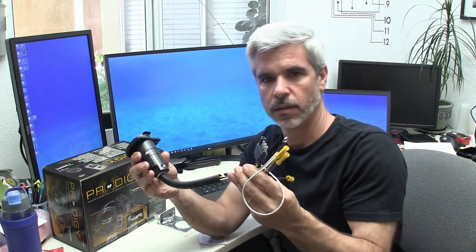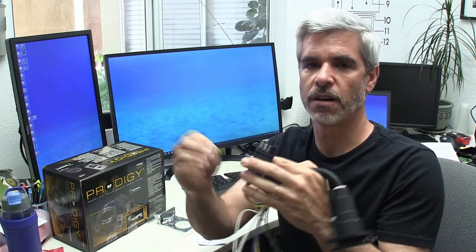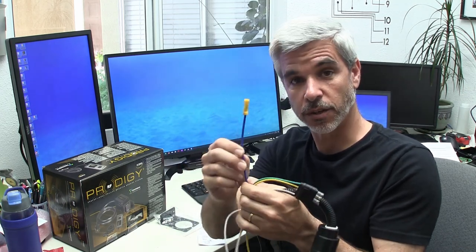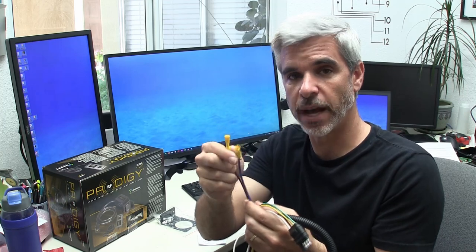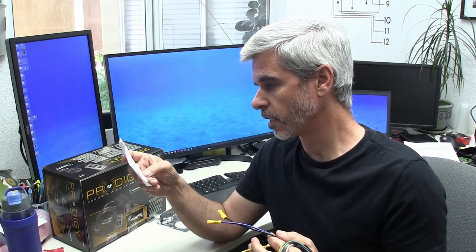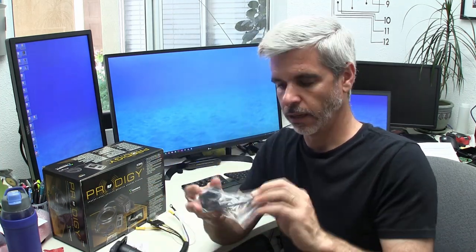So what we have here is a harness — a standard 7-pin trailer connector — and this is going to plug into the existing connector. We're going to take off the old connector that's there, mount it on the back of the trailer, mount this into it, and tuck this up behind. The blue wire goes to your brake controller if you're installing a brake controller. The black wire is a 12-volt lead that needs to come from all the way up from the battery through a 30-amp breaker. The yellow is the backup lights, which apparently is not part of the standard 7-pin connector. The white is ground, which is going to connect to the chassis back there in the bumper area. And finally, we have a nice bag of brackets and all the hardware to mount this.